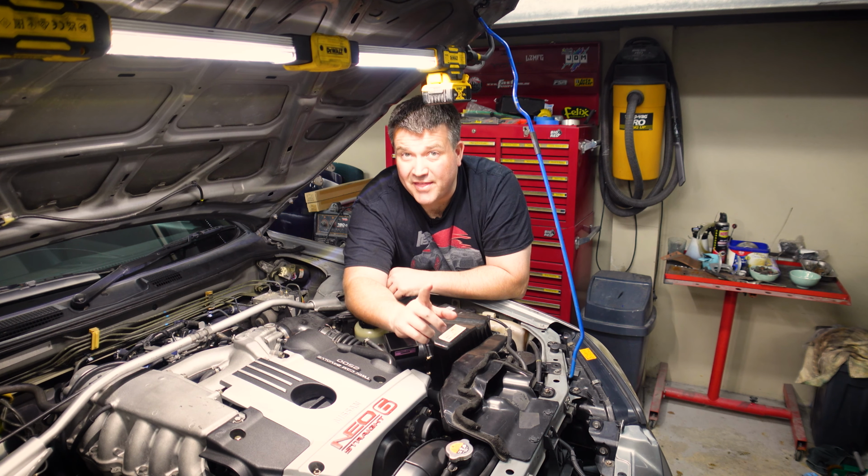So that's our 4 litre mark. And you can already see the difference between those 2. I would much rather have this stuff in my gearbox than this old crusty muck. And the reason I'm marking out 2 litre increments on this is because 2 litres is about the maximum underfill that I'd be happy with for the AT in order for it not to start chewing things out.